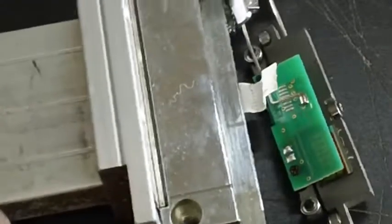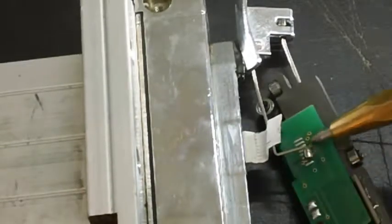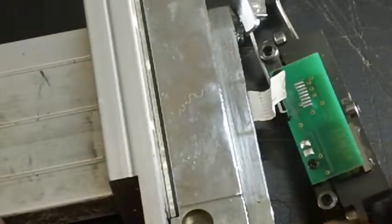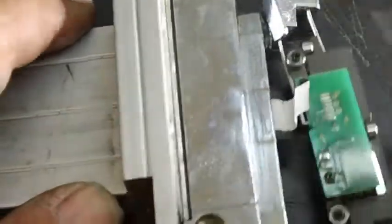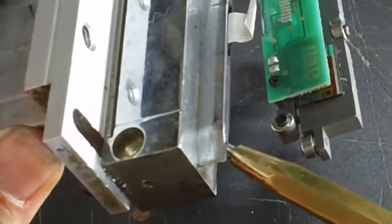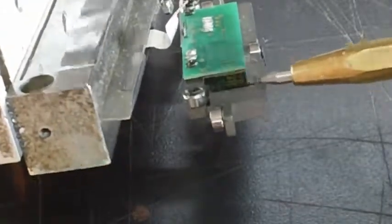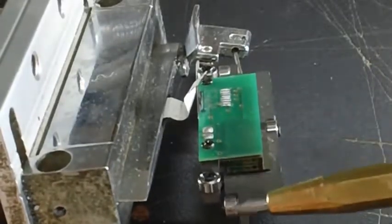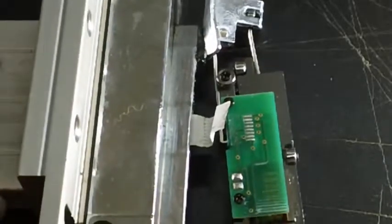When the thing canted and broke, it actually pulled this ribbon cable here from these contacts, and that's a pretty easy fix — splice this back and re-solder onto there. This part right here keeps it inside the track on the back end, and there's supposed to be a piece of metal on the front end to keep it aligned inside the track so it can't come in and out. This is the reader head that actually spans the glass, and you can see the actual reader inside with roller bearings on the bottom and the top that allow it to track along the glass evenly.